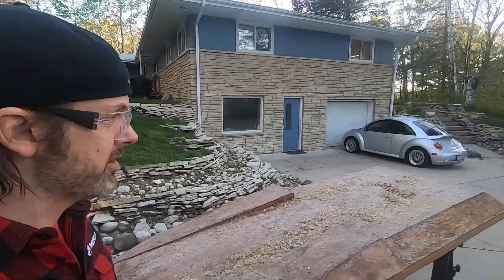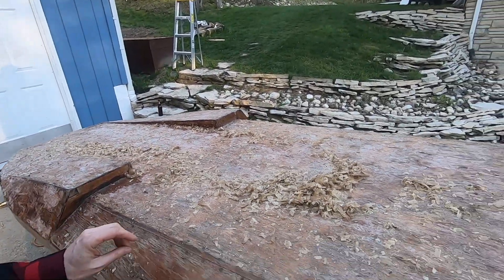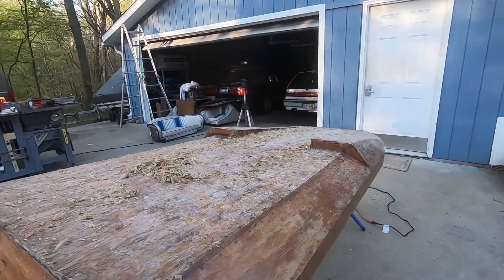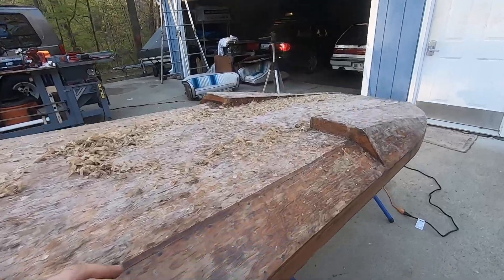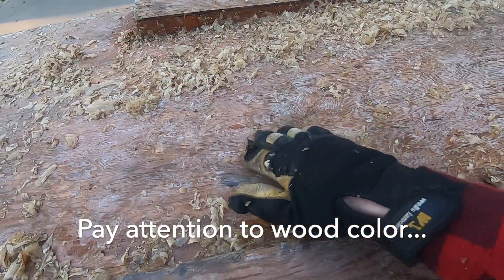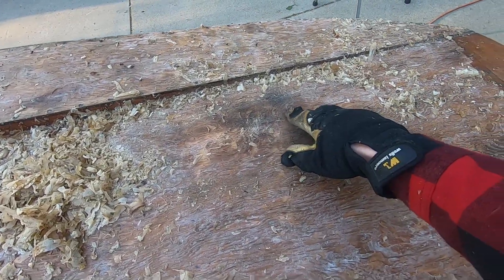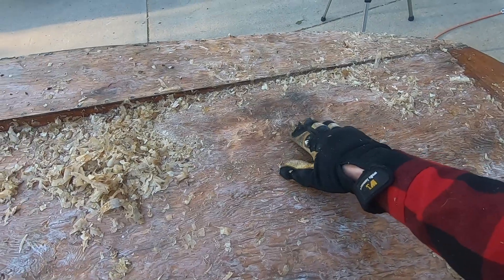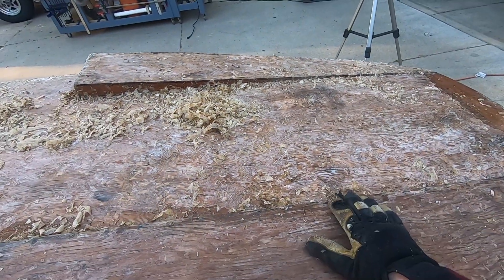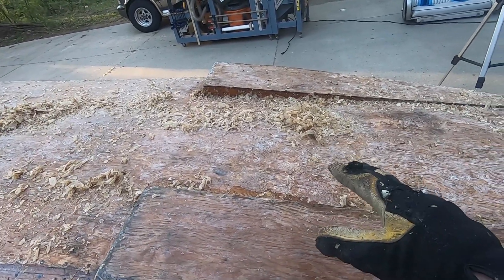I think I've reached a stopping point — the sun's about to go down but I have the majority of this hull scraped. I still need to get the sides and everything. This is a lot of work but it's not too bad — this was just my lunch hour and after work. A couple things I've learned: when you see a darker area of wood, it probably means that wood is not in great shape. My putty knife was digging in a little more in those areas. The wood doesn't feel spongy but it's not totally healthy either. We're going to sand this and do some epoxy coatings to make it last as long as possible.